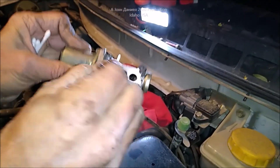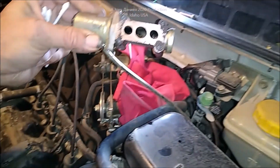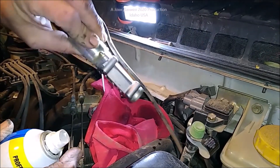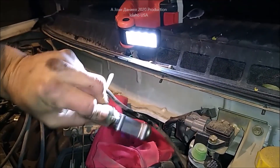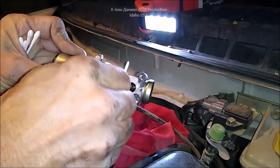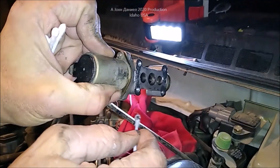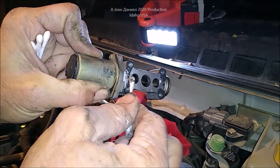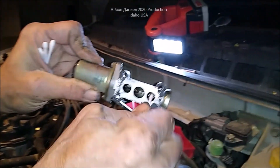That's what's inside not allowing this to fully function. You'll take q-tips and get in there carefully and clean it — don't leave any fibers of your q-tip in it. You can see in there how nasty that is. I'm going to flush it here onto the rag — you see all that nasty stuff coming out. That is the cause of your idle air control valve not working and you not being able to maintain idle. Especially on cold days, you'll have a lot of buildup. There's the valve that opens and closes — when it opens here it also pulls the other one back and allows air into the engine.